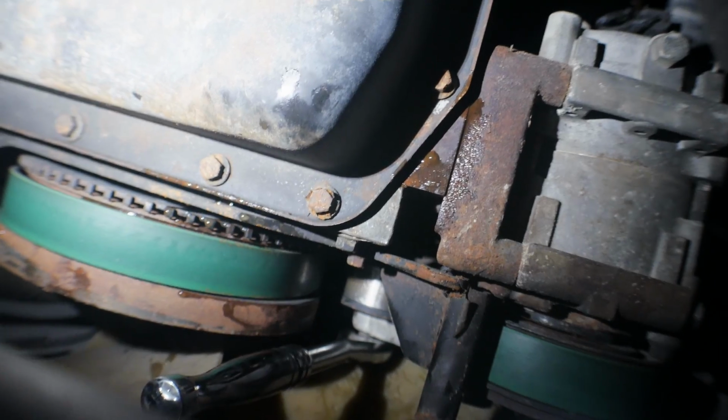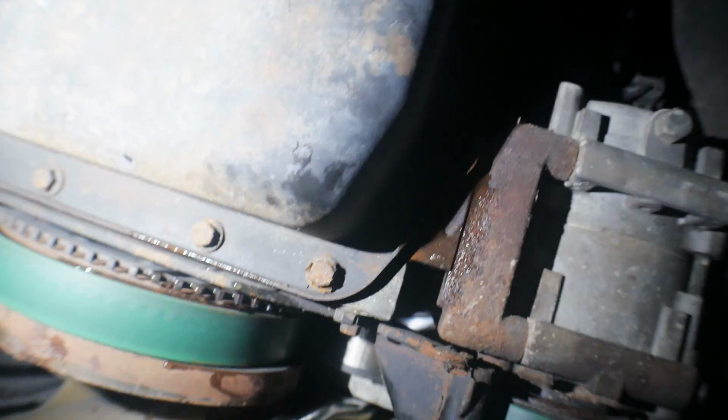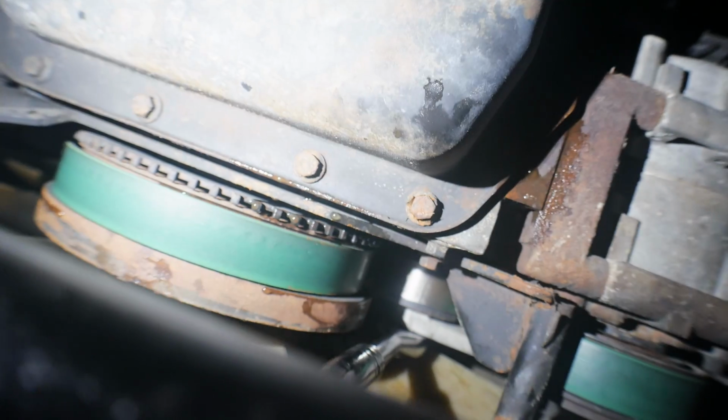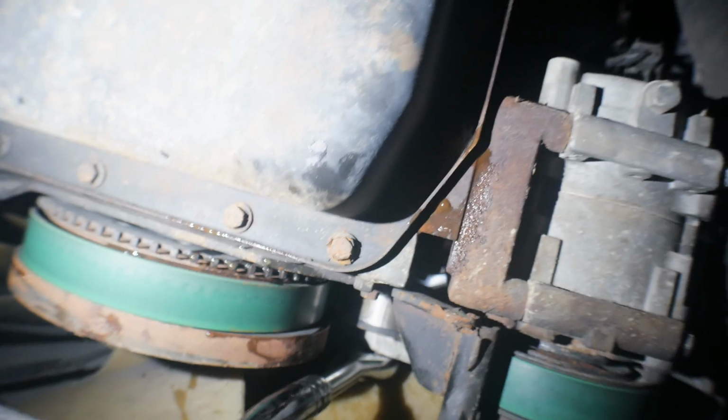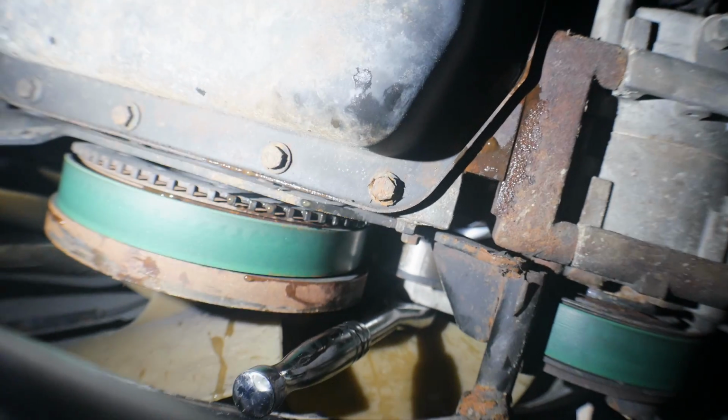So right there, he's just getting a 1/2 inch wrench, or 1/2 inch standard size ratchet. Just plug it in and then you just crank a little torsion on it and it'll loosen the belt off. It'll be easier with 2 people. That way you can have one person take the pressure off and then the second person take the belt off. All you do is take a 1/2 inch ratchet, put it on the bottom of the tensioner, put some tension on it, release the tension, take the belt off, and again, it's easier for 2 people.